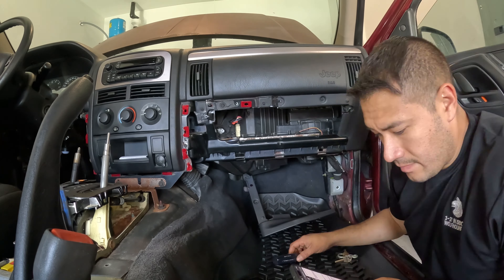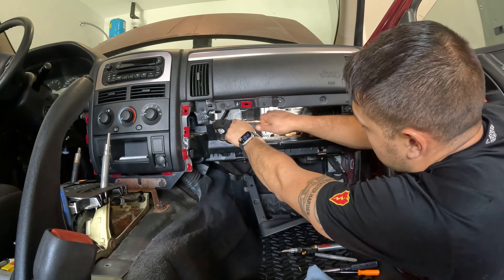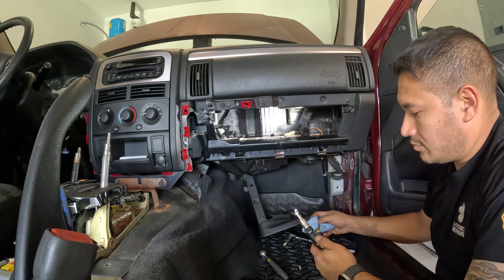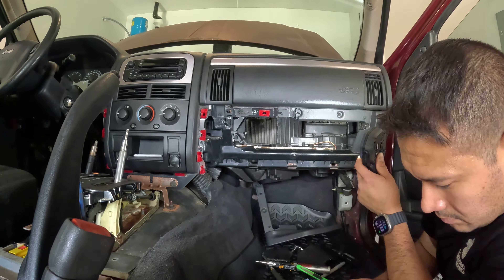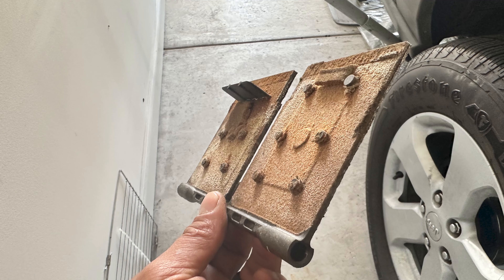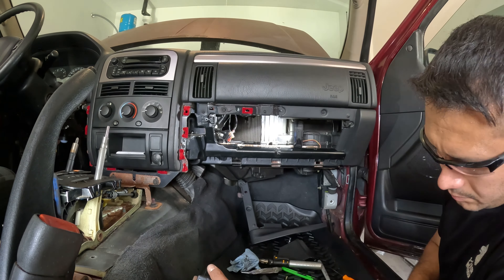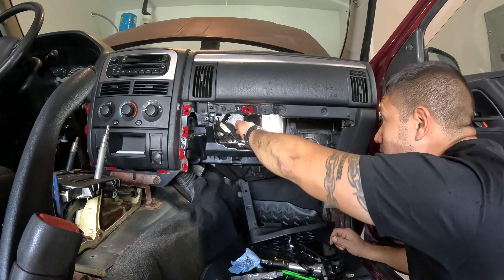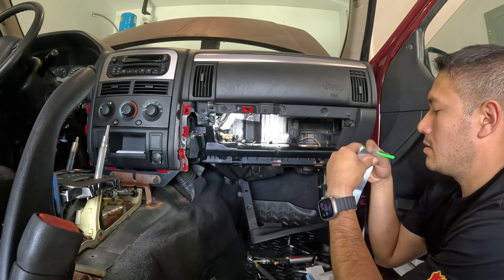When I started driving the Jeep, I noticed there was an issue with the AC blowing warmer on the passenger side, and after checking the refrigerant level I attributed the issue to the blend door nearest to the heater core. Since this was a common issue, I bought a blend door repair kit and a butane heat tool, and got to work. After removing the glove box and trim, I removed the motor and cut out the required outer and inner sections, then removed the actuating bar and blend door before replacing them with the new metal parts. The problem with reinstallation was that the new actuating arm did not align with the motor, and I could not get the motor to operate after adjusting its position. I ended up running to O'Reilly's and replacing the motor with a new one, which worked perfectly.